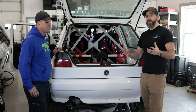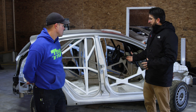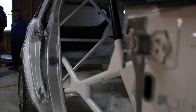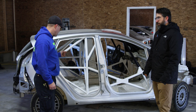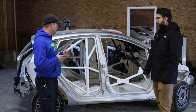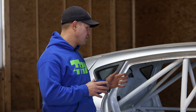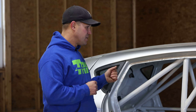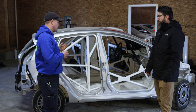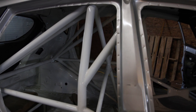Now let's look at an example of an FIA cage. This is an M Sport homologated FIA cage, engineered specifically for this chassis only, and the certification carries authenticity with it. One of the biggest pros is it's the lightest possible design — everything is built to comply at the lowest possible weight. Some concessions are that it's not as ultimately strong; tubing sizes are much smaller and there is inherently less total strength.